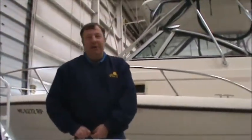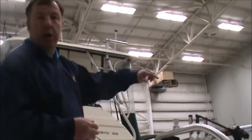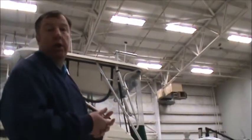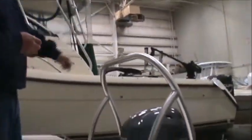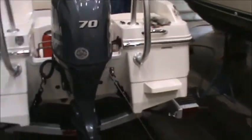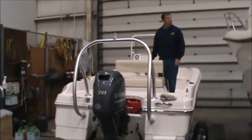The engine is running. You've got more exhaust noise right now because of the way we're out of the water — your exhaust comes right out from the prop. Caleb is going to walk around to the opposite side of the engine and show you the sight stream that comes out of the side of the engine. That shows you that the engine is pumping water. That's an important thing to look for within just a few seconds of starting the motor to make sure the engine is pumping properly.